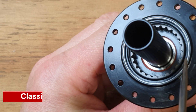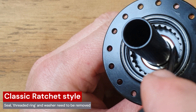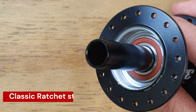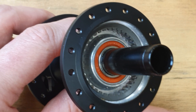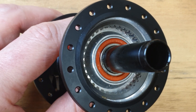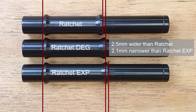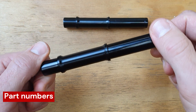By oversizing all of the internals, two really important features are opened up. First, if you've ever serviced a Ratchet or Ratchet EXP hub you'll know how hard it is to remove the threaded ring to access the drive side bearing — these can be bloody tight. No more. On the Ratchet Deg hubs the drive side bearing can be easily removed. Secondly, the extra space means the drive side bearing is moved outwards, giving the bearings a wider stance which should lead to both better bearing life and fewer broken axles.